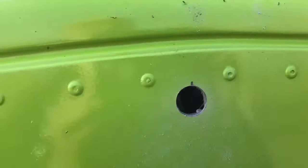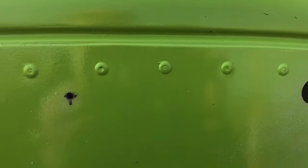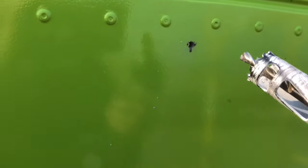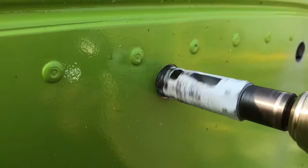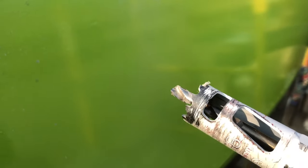I went up here and I drilled pilot holes. I got my spacing — they had to be at least six inches apart. So they're very close to where they were before. I already drilled one and it's not too hard going. It's got to go through metal and then through fiberglass, but I've been using the Milwaukee hole dozers hole saws and it'll go through this pretty easy. There's the first layer of metal.